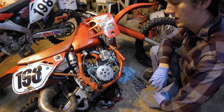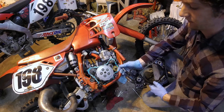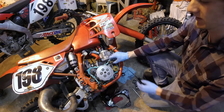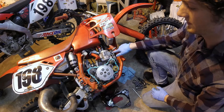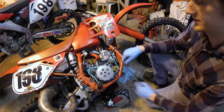So here we are over at the bike. A few main components we're going to be talking about is the power valve linkage, which you can see here, the centrifugal actuator, which is this guy right here, and the power valve itself. The power valve is in there — you can't see it right now, but this is the little part that the linkage bolts to.